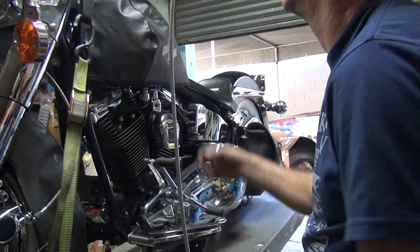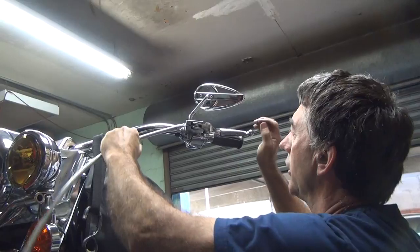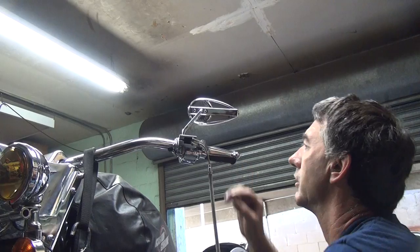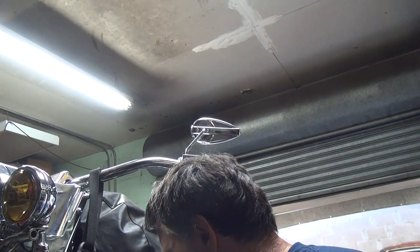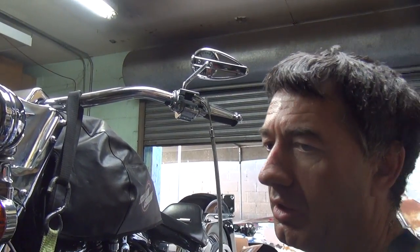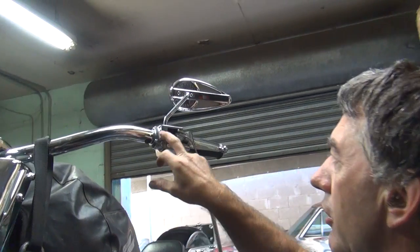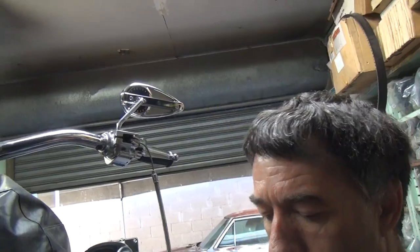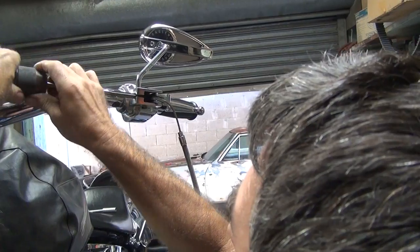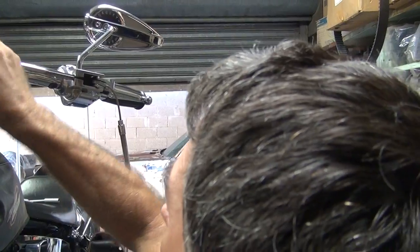All right, we got this new cable all lubed up and we're putting it on. The damn thing won't fit inside the housing up here. Stupid parts never fit. I measured the cable: it's .367. The hole's .356-.357. And 3/8 should be your standard size, which is .375, so this is undersized, full of chrome. Who knows what the problem is. This is a .373 reamer, which is undersized, so I'm going to stick that in there and cut that hole back out to how it's supposed to be.